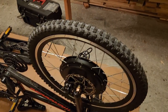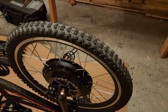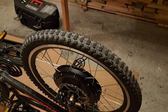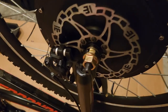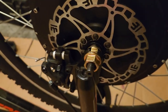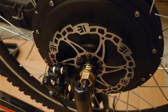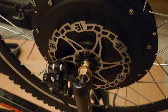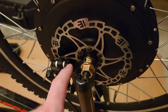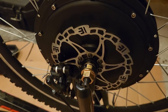Now the tire is on. The process is simple: deflate the air from your existing tire, peel it off, and transfer it onto the new motorized wheel. You'll also need to transfer your disc brake. For me this used a Torx screw — just loosen it off the old wheel, pull it off, and stick it on the new one. The best way to tighten it so it stays straight and true is to tighten in a star pattern, going in opposites so everything is nice and balanced.